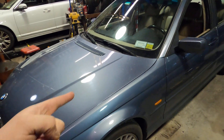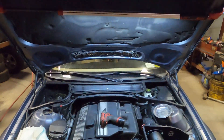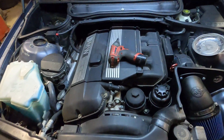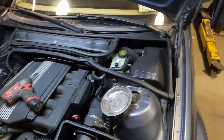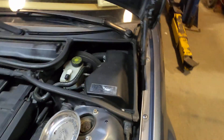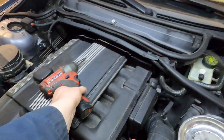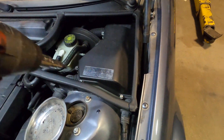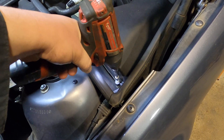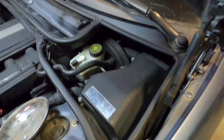But we never know, so let's get started. First we're going to open up the hood and locate where the computer is. Hood open, light on, time to get started. So first we're going to locate the computer and where it sits in the BMW. E46s with an M54 engine - the computer is over on the driver's side, upper corner here. If you're looking at it, it'll be upper right; if you're sitting in the driver's seat it'll be upper left. We have four torx heads here. We're using the Milwaukee gun with a torx M5, so we're just going to be taking all those out and lifting the cover. Any loose bolts - better to have this little magnet tray here so you don't lose any of them.